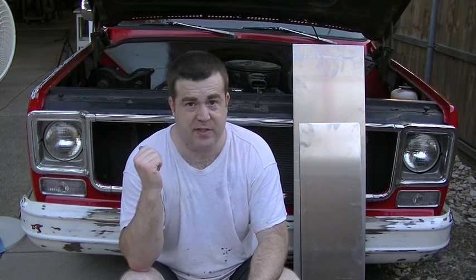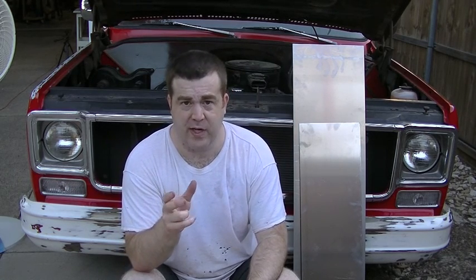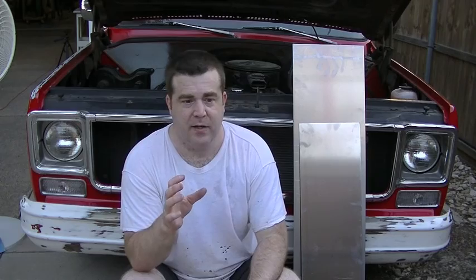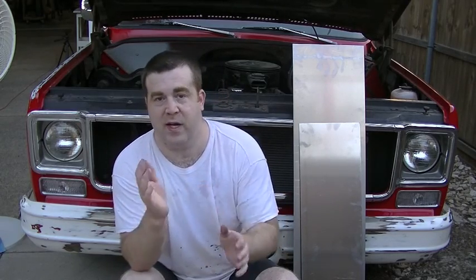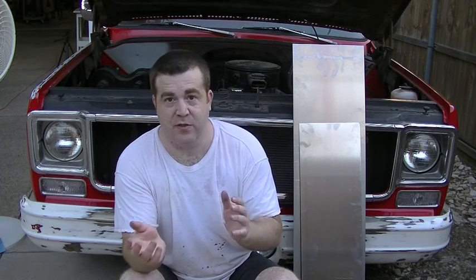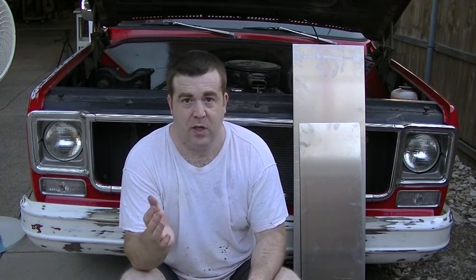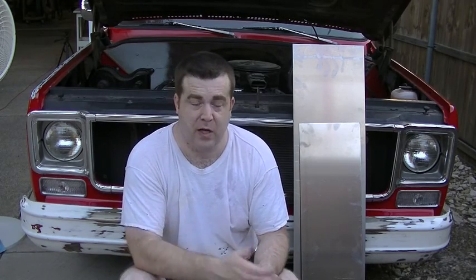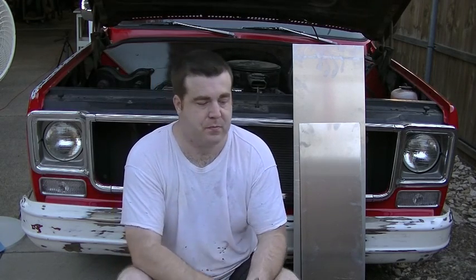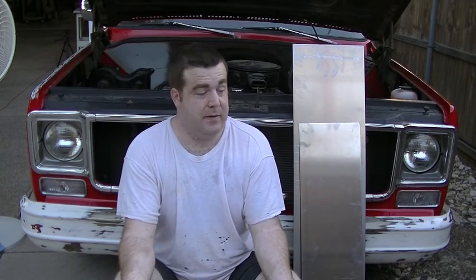And I'll probably go with a different manufacturer for the thermo switch, and probably a little bit cooler range, something that turns on at 185, 190 and turns off at 170, 175. And I may run two separate thermo switches, one for the hotter months, one for the cooler months. So that's about it. It was well worth it.